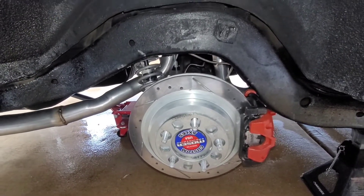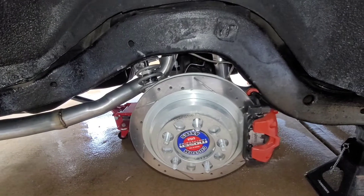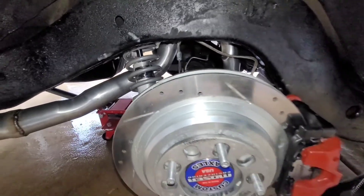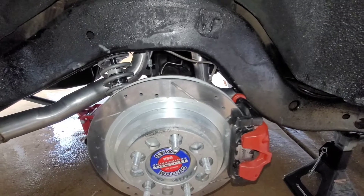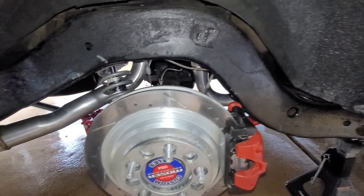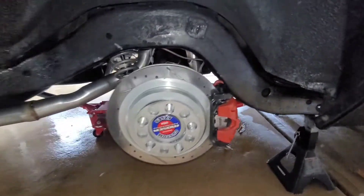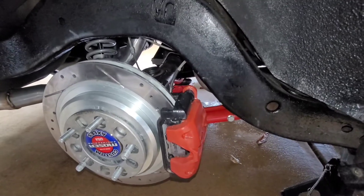Out of the hydro boost there's a pin, and in your master cylinder there's a pin that goes in it. Sometimes you have to shave that pin down and make adjustments. I didn't have to do that because when I put the MC on it, it went flush. I checked that first. When I pulled the MC away from the pin, the calipers were still tight — all of them were tight. I thought it was just a back one but they were all tight, so I pulled them all out. This is the last one I've got to bleed.